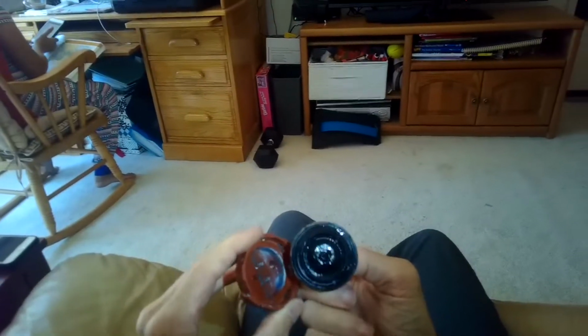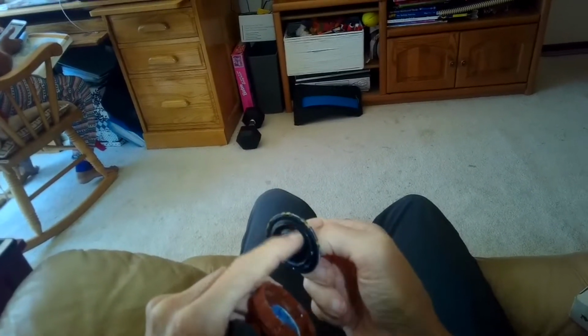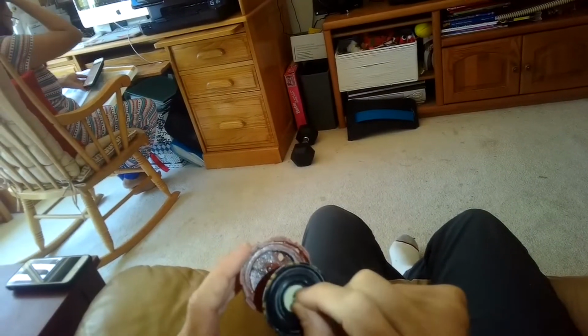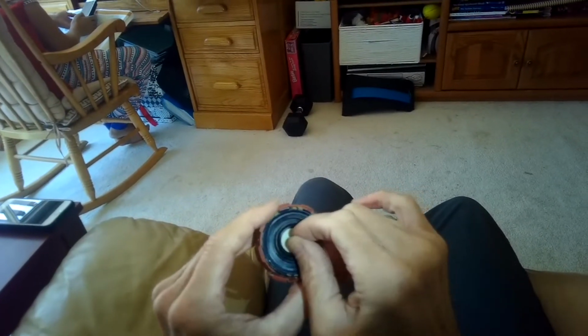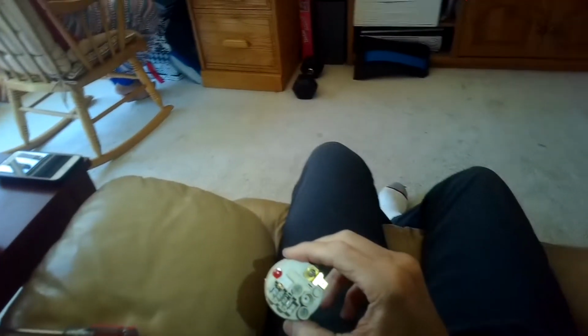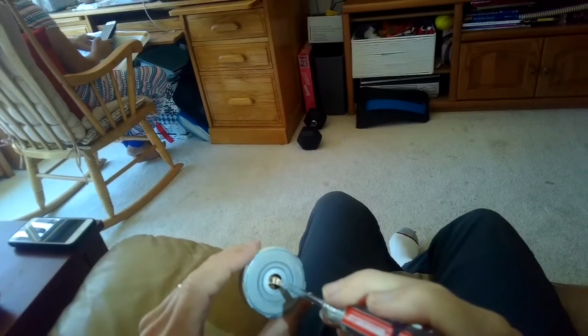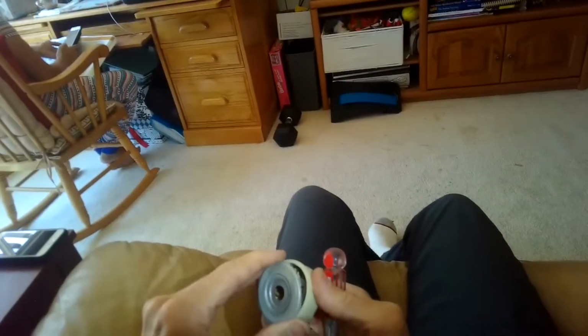and he mentioned that on theirs there was a tear in this membrane and they were able to repair the tear with silicone. So when the pressure comes in through here from the pump, it pushes on this diaphragm, pushes this up, and as that goes up, it pushes in on this piece of copper right here, and that closes a little switch to tell the computer that there's enough pressure. Let's take this little plate off.